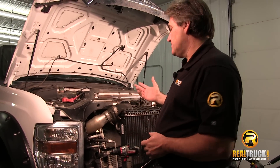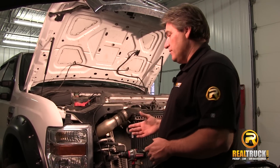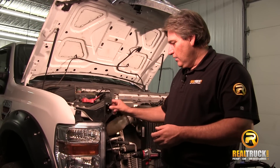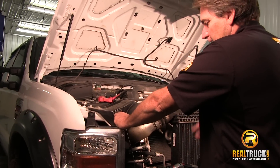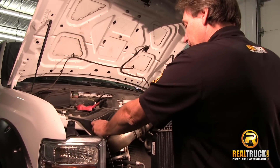Find a location where we can actually install this. As you can see here, this being a diesel, there's not much room under the hood. So what we've come up with is a location right here on the front by the headlight where we're going to be installing our mounting bracket for our control box. So we're going to install the mounting bracket, get our control box on here, and then we'll start actually hooking up the wires and show you where those go.